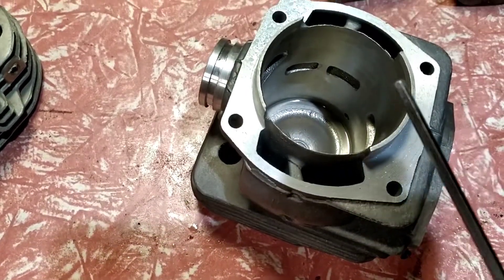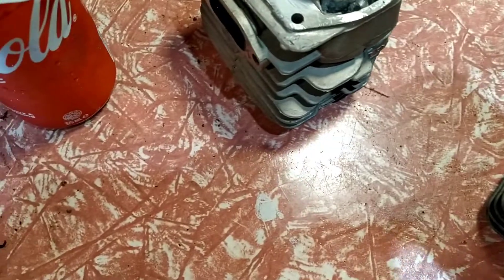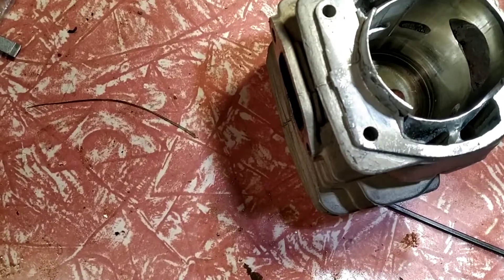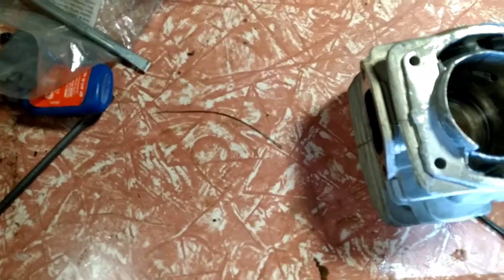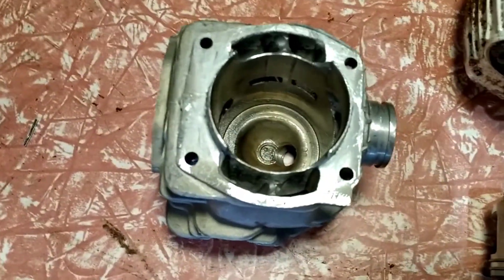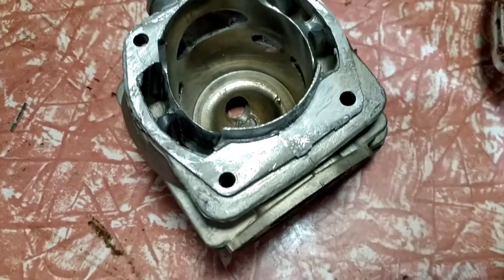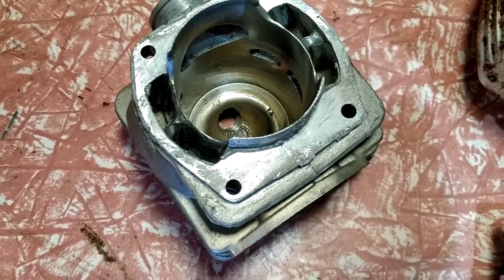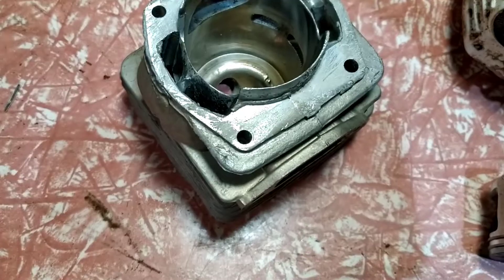Finding that clip missing — I've gone for the muffler, can't find it, so it must have pulled out. Gone through the cylinder. You can leave the marks in here — yeah, there's one mark there — it's shot out through the bore. There's a bit of a mark — see that little mark there? The clip's fallen out, gone through the transfer chamber, blown out the top and made its way out.